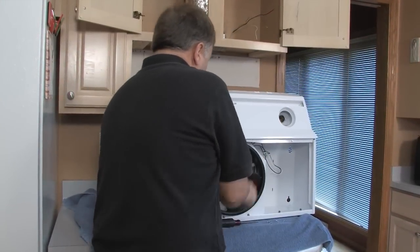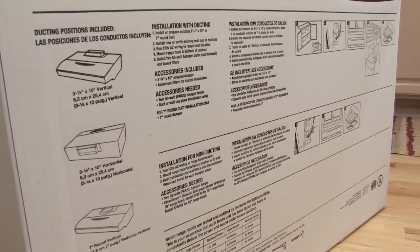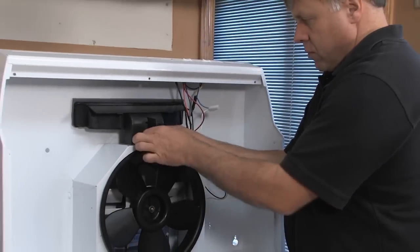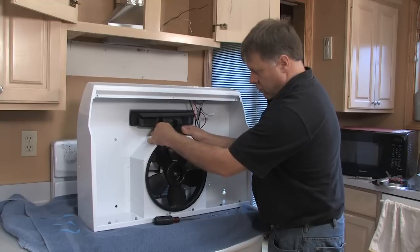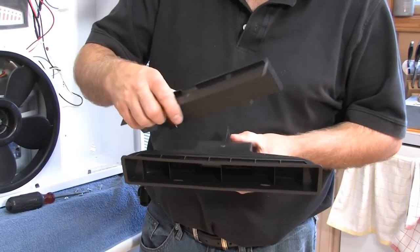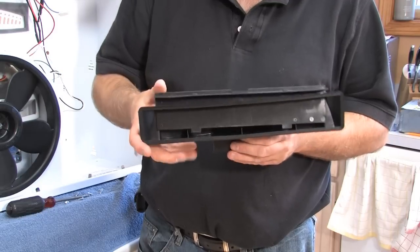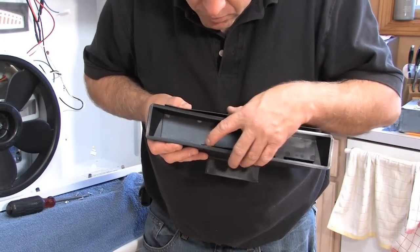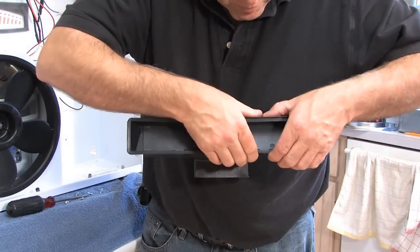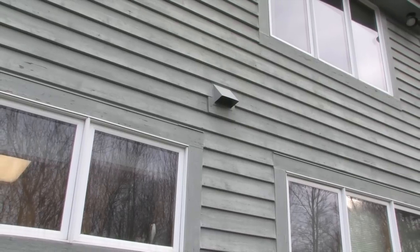Remove the light panel, which is held in place with 5 number 8 screws. Disconnect the light assembly wire harness. Allure range hoods are set up for non-duct recirculation that must be converted when being ducted to outdoors. In the case of the Allure 1, remove the air chute, which is held in place with a screw, being careful not to disconnect any wires. Now remove the baffle from the air chute. Rotate the baffle, then reinsert it into the air chute so that the baffle tabs fit all the way into the slots. A click will be heard when it's fully installed. This will close off the airflow through the non-ducted slots on top of the hood, allowing the air to be directed to the duct.